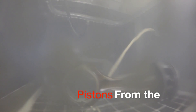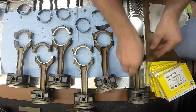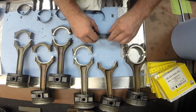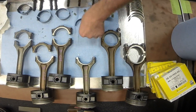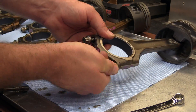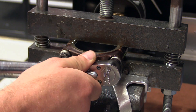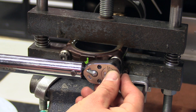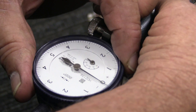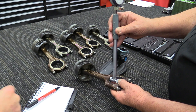Once our crankshaft is fully installed, it's time to move on to the pistons. Just like we did with the crankshaft, we want to spend a good amount of time cleaning the pistons. Next, we're going to assemble the pistons and connecting rods. We're going to install new bearings, clean the backside of the bearing and the connecting rod cap to make sure there's no dirt or debris. After our bearings are installed, we'll get our new bolts and torque the caps down to 30 newton meters with no stretch — this is to measure oil clearances. This is our last chance to catch any potential issues, and perhaps one of the new parts is not in perfect condition.